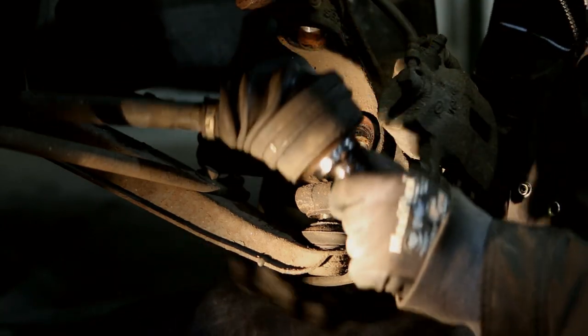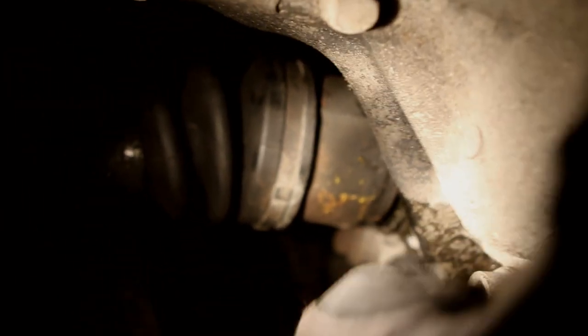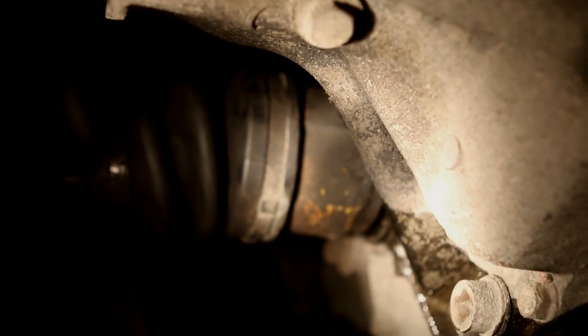With a little help from my lovely assistant Ruben, the axle is out. In order to nudge the axle out, you need some kind of wedge between the gearbox and here. And don't be too rough, because you can damage the seal that's keeping the oil from leaking out.